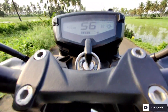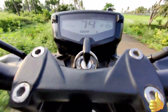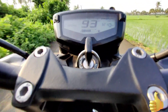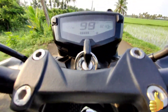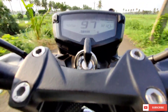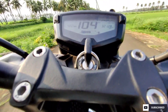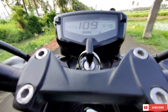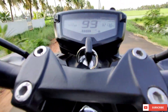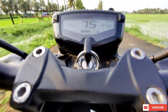As you can see, at a speed of 110, I downshifted from 5th gear to 4th gear and I cannot notice any jerk in the bike. But if you do the same thing with a normal clutch, your tire is going to get locked and you will lose traction. With the help of the slipper clutch, as you can see, the RPM of the bike was raised but the traction of the bike was stable — the tire did not get locked.